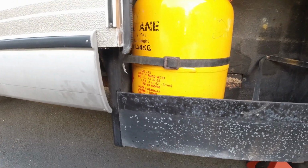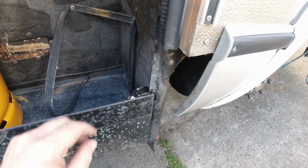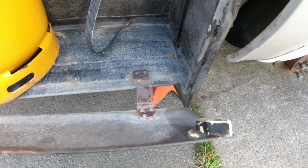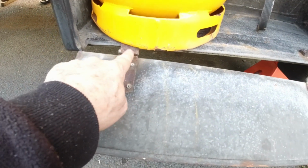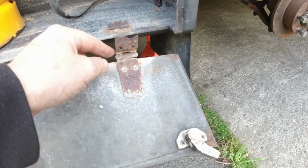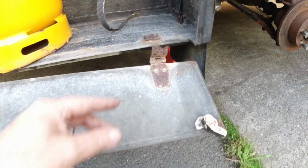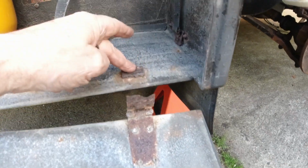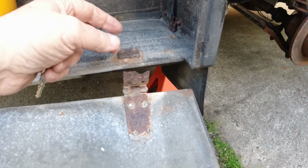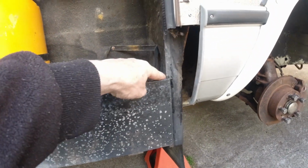And now we're going to continue on with these guys over here, and there's a hinge. So that's one of the next jobs to do. I've oiled them already. Now the hinges, obviously they're not worn, the hinge itself isn't worn, because how would it? But this has rusted away, so I'll probably just cut across here, put a new piece of metal, take this old metal off here, and put the new piece of metal back on there. And because it's all good around here, just clean it all up and paint it. So that'll be for the next one, guys.